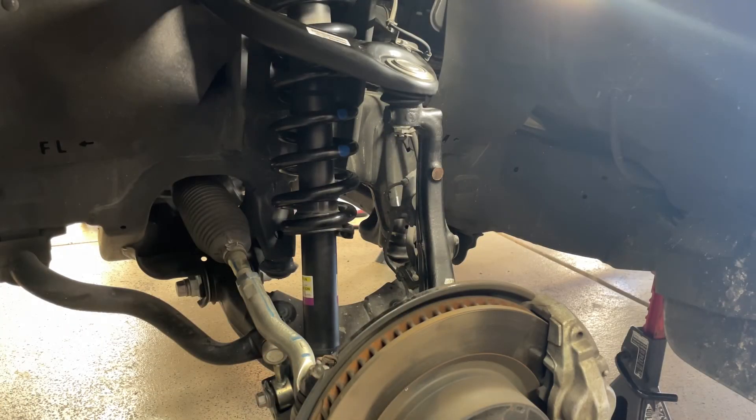As always, the second one is always a little easier — it wasn't too bad. Same thing: disconnect the ABS lines, brake lines, sway bar, the top spindle nut, the strut shock — four bolts on top and one at the bottom came right out. Put the spacer in. Now since I'm doing this I'll probably rotate the tires from front to back and back to front. Once I do that I'll get a measurement and see what the difference is.